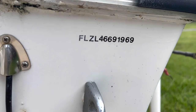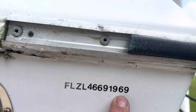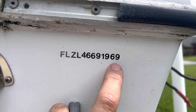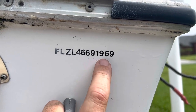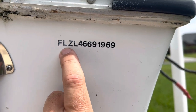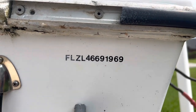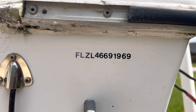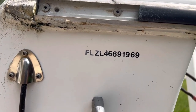The whole ID number right here — even the title says 1969 because the last digit is 69, but based on this VIN format, this shouldn't even exist. This VIN format is from like 1984, if everything is correct as far as decoding the digits and letters. And that format didn't even exist until 1984. Boats weren't even required to have VINs until 1972, so if this is a '69, it really shouldn't even have a VIN.